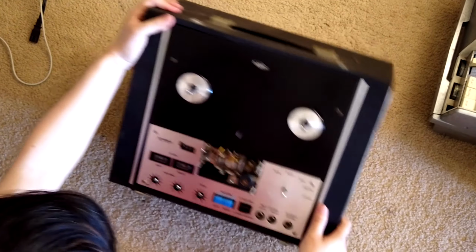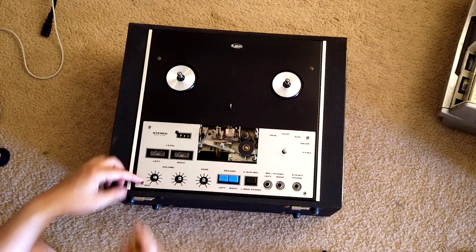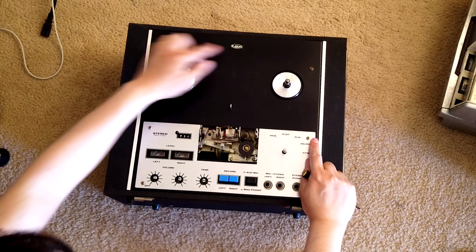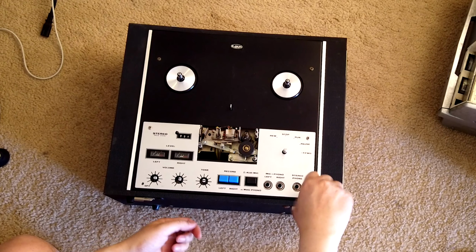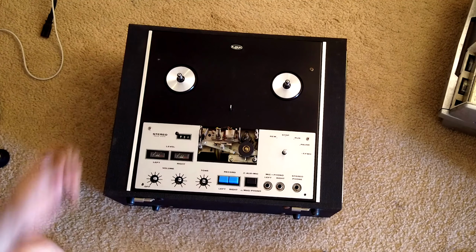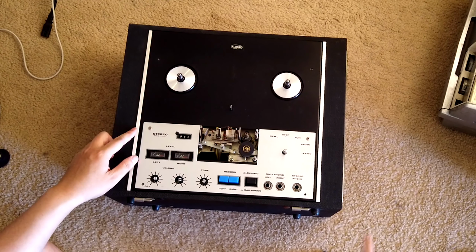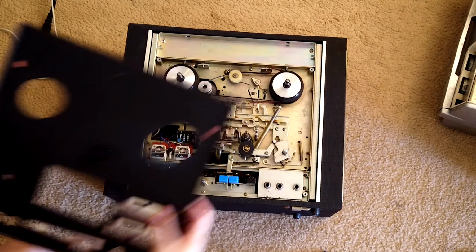After that, let's put this down this way, and then we can loosen 4 screws. This one, this, and that. Do not touch this and this, because that's not for the whole front plate. This is to hold just this plate. So don't touch those. But let's loosen 1 screw, 2, and this, and this. Again, you only need to loosen 4 screws here. Do not touch these 2. After that, it's easy to just lift this, just like that.